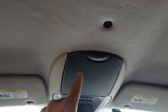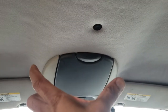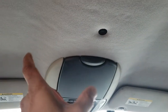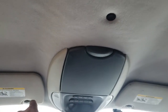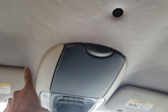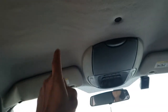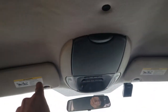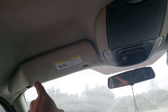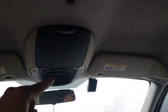When you're installing this part it's very difficult — there's actually a little frame above this that needs to line up perfectly in order to put everything back together. When taking it down it doesn't matter because it all comes apart separately, but when putting it back up it's very difficult to realign these screws to the frame. The frame goes across here and attaches to the roof. The two main difficulties were getting these out and pulling the headliner out, and then when putting it back in, getting these realigned and getting the visor screws lined up properly — this took most of the reassembly time.